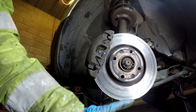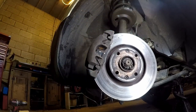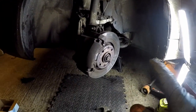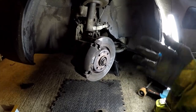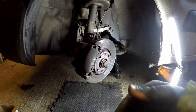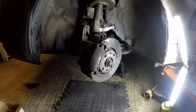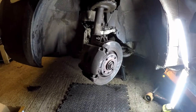All we're going to do now is pump up the brake nice and firmly, then spin the wheel and turn the disc to make sure it doesn't bind. There's a bedding-in period on old discs and new pads — same would be true with new pads and new discs. Basically, go down the road nice and gently, brake quite firmly from about 20 to 30 miles an hour three times in a row, then drive for about half a mile to let the brakes cool down. Repeat the process — 20 to 30 miles an hour three times, then drive half a mile to cool down. Then brake quite firmly from 40 or 50, make sure it feels good. Just make sure when you do hard braking initially, you drive a bit afterwards to let the brakes cool down and you don't glaze up your new brakes.